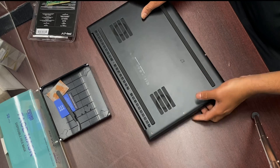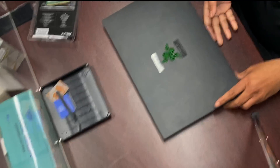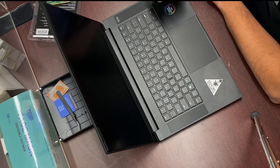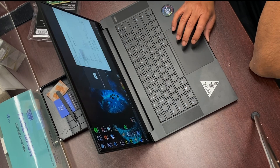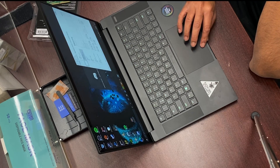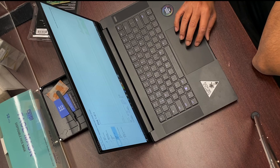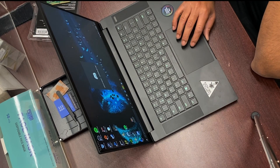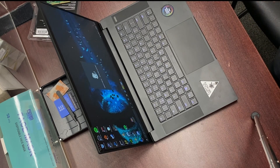If you want to know how to check the RAM and how to format your SSD that you've just installed, I'm going to show you later in the video by taking a screenshot of the process. Once you are done installing everything, just before putting it back, make sure everything is working. Because sometimes one of these SSDs or RAMs are faulty, and then you'd have to reopen everything again. So it's better to inspect everything — go to your Task Manager and check whether you're getting the amount of RAM you installed. Then check via Task Manager again whether your SSD is readable.